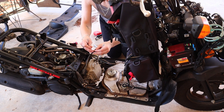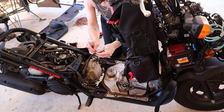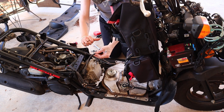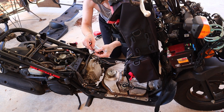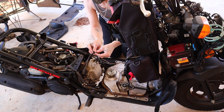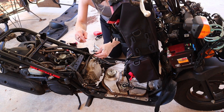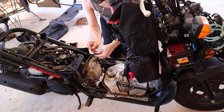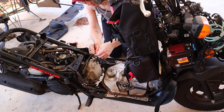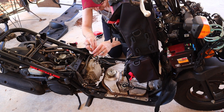This is an induction coil basically, so what it does is it senses the electricity going through — I'm sure it uses the right-hand rule from electrical principles — to measure the rate at which the electricity is going through, creating a magnetic field around the wire, which it measures and then displays on the screen the RPMs of your engine, which is extremely helpful for about five thousand different reasons.